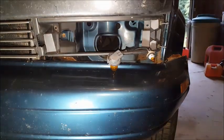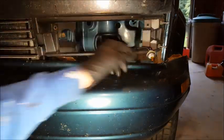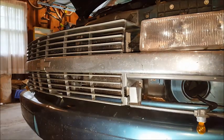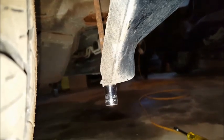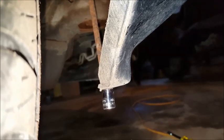And then this whole grill should come off. I took those two screws out — one that goes here and one that goes right there — and sure enough, this grill comes off, just like that. Next, in the wheelhouse here, there's a support bar that comes down to the fascia, and there's a nut on the bottom that will have to come out. I've got a socket there — ten millimeter on that bolt for the support bar.